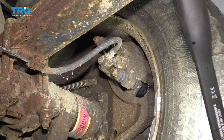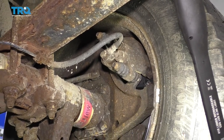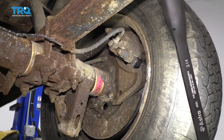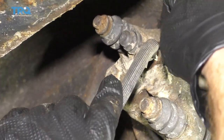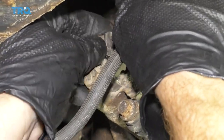I have access to getting underneath the vehicle without having to remove the wheels. If you do have to remove the wheels, do it safely. When you put the wheels back on, make sure you torque them to 150 foot-pounds. One of the first things we want to do is get off this bleeder screw cover — just take a small pocket screwdriver, get under there, and pop it right off.